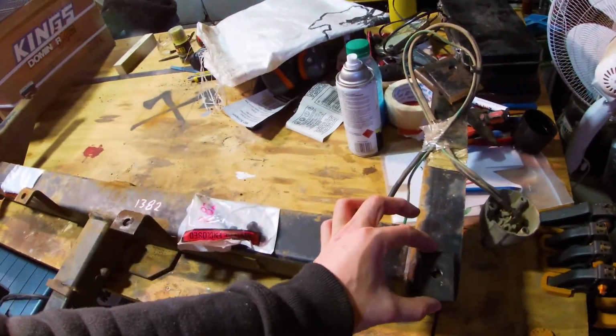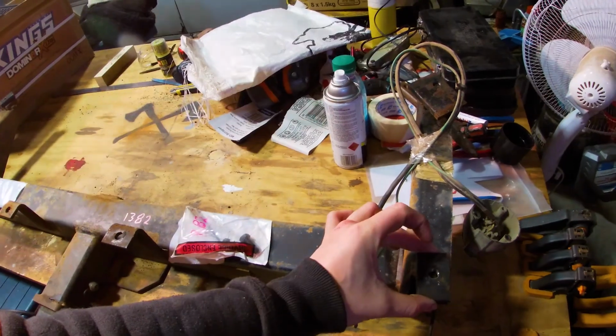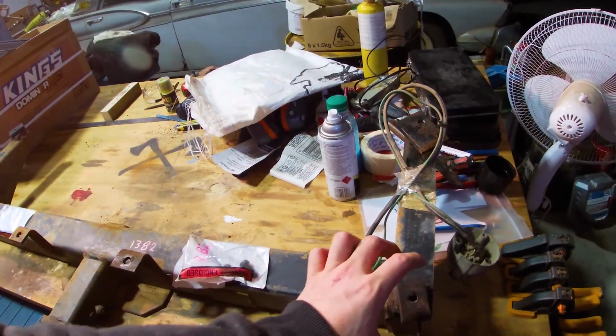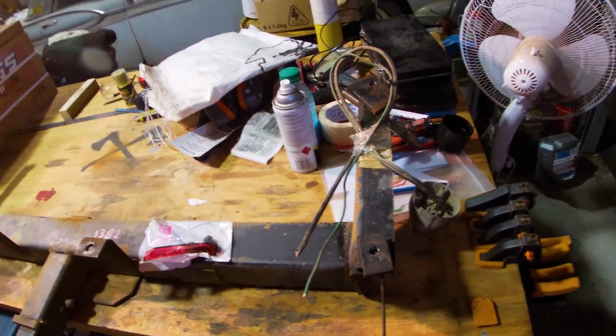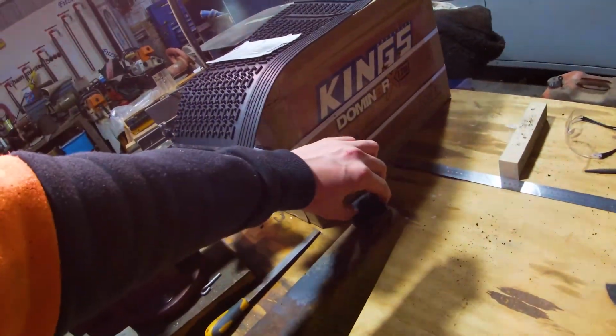Then once we finish painting, you can see here with the actual pieces of metal that go into the chassis rail to bolt it in there, some of them have this wire in there, so you can feed it into the chassis rail in order for you to put the bolt up and you don't have to use long nose pliers and all that. So some of these are missing them, especially like this one over here. That will need one welded back on, so we're gonna have to weld some of those long sticks on first before we put it on.